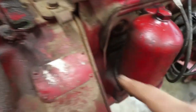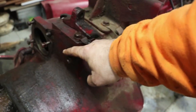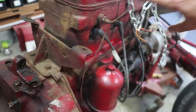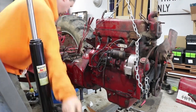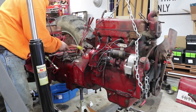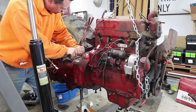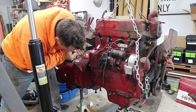I've still got to figure out how to get this out. I think I need to lift the engine and then gently slide it with that nut removed, maybe just tap on the end a little bit to get the engine away. There was a little bit of corrosion on those top two threaded rods, which made it more difficult. I don't even know why those were threaded rods instead of bolts — maybe the last person to replace the clutch put it back together with threaded rods and nuts thinking it would be easier for a future replacement. But it confused me because it's not what the manual said.